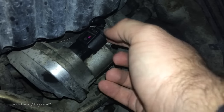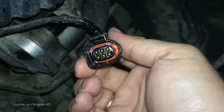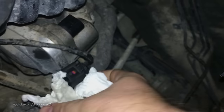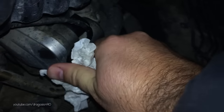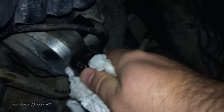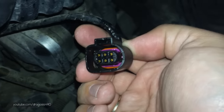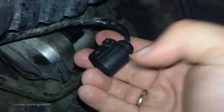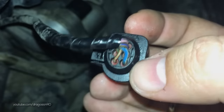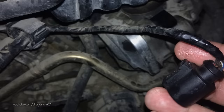What I discovered through trial and error is that if I clean this connector with WD40 — here I already sprayed it and just decided to make a video about it to show you how to fix this — this is really working for me. I never had the time to actually look at the wiring, but it might be just that the wiring is having problems and when I remove it, it gets fixed. If I spray it with WD40, I will not have any problems with it for at least one year.